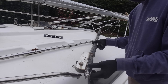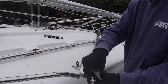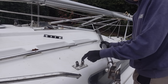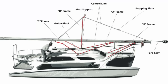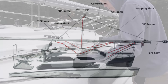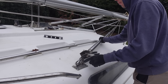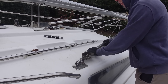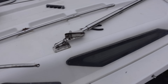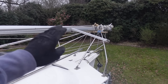I've roughly adjusted the length on this thread here - wound all the way down, three threads off. Done the same on the other side which I've already attached. Just got to slide this pin out. So I've got to attach it to this aft most one which seems a little weird but that's what all the pictures show in the diagrams. I'll just pop this pin in - it's not the tightest fitting of the pins. About half the width of that flange is another gap so I could put washers in there if I wanted it tighter, but I think it does have to be somewhat loose because of the angle it's at to where the mast sits. I've put it underneath these shrouds because when this mast picks up it tilts forward, so you want all of those to be up to the side.